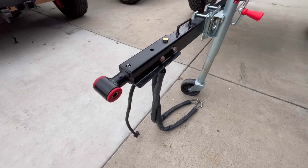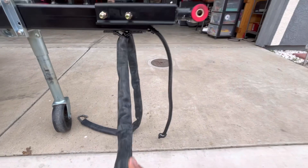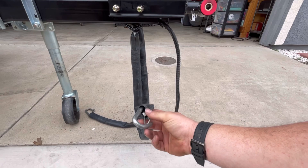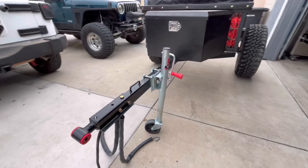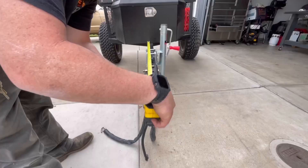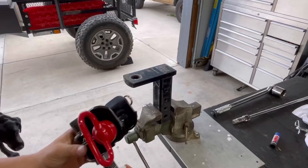I'm very happy with the install on that. I've got the third bolt — this is more of a security bolt — but everything's looking good. The safety chains came out really good and all the welds turned out pretty good. I really like the sheathing to protect the metal from getting beat up and scratched up over time. Got the ground bolted back onto the tongue for the electrical. Let me give you guys a measurement from the box to the end — I'm exactly 40 inches, so 3 foot, 4 inches.